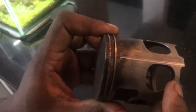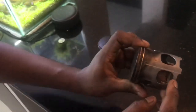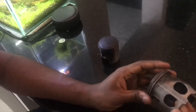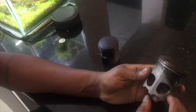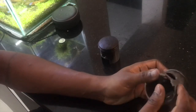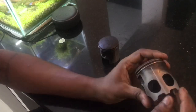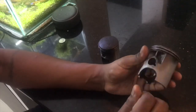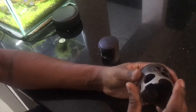So that was kind of dangerous. This is the kind of play that you do not want to see in your bike. So I used the opportunity to replace the clutch bushings also. I got those and replaced them. This is your opportunity to check if there is play. Play can be checked very simply. You just need to hold the bell in one hand and try to twist it in both directions.